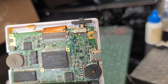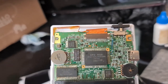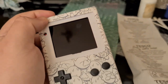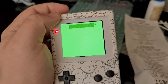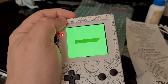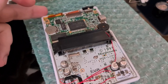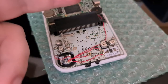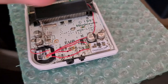Once the ribbon cable's attached, the right-hand side is going to the first pin on the power switch, and the other side is going to the touch sensor at the top. That was the hardest bit — trying to get that to fit with the Kapton tape, it was so fiddly. I really need to find my tweezers because that would have helped so much. The batteries are in, and there is a fingerprint on there because I did touch it. I'll clean it off with LCD cleaner. Testing it, and as you can see the screen is wonky — so open up again and move it.